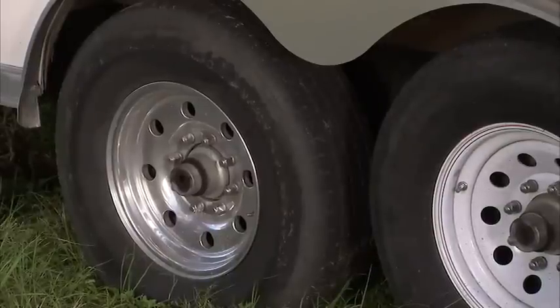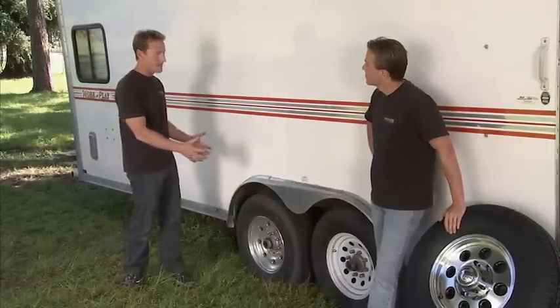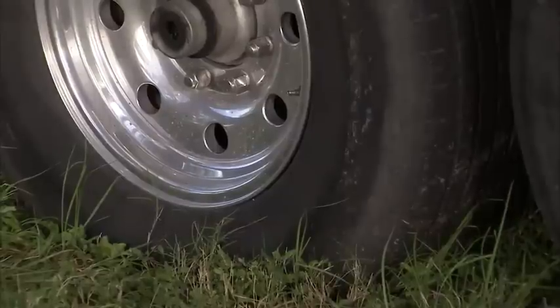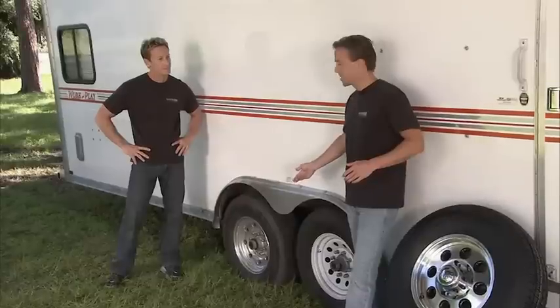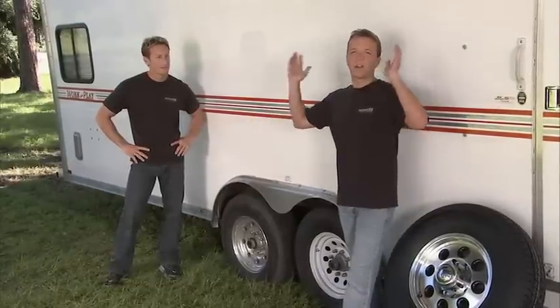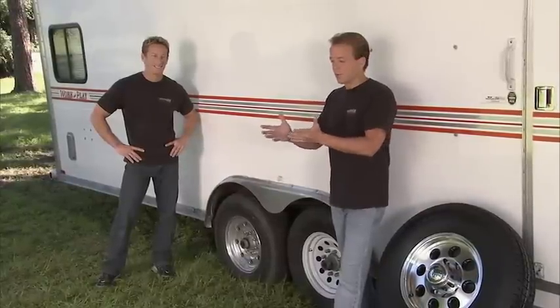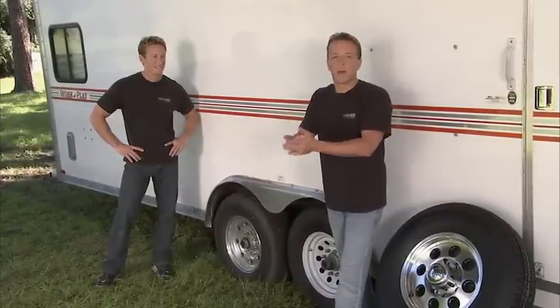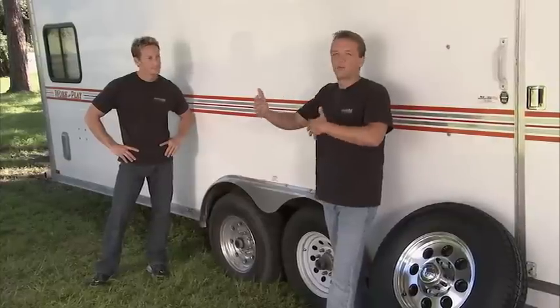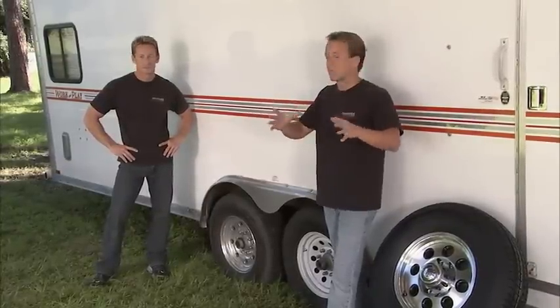Issue number one is right here with these tires. Trailer tires are often neglected and stored incorrectly. Right now this trailer is sitting in dirt and grass, and what happens is you've got moisture buildup sitting there for months, eating at the tire and making it go flat. Another misconception is thinking that using a trailer tire only four or five times a year means it'll last forever — that's not the case. You've got to think about the duty cycle: it might be used 24 hours non-stop and then sit for six months, creating an unusual wear and tear pattern. You want to make sure you have the right tire for the specific job.